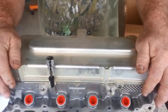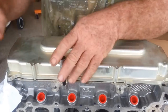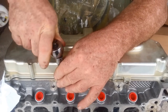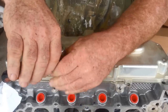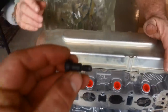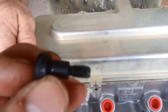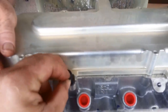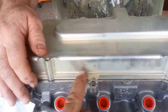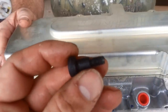There's one bolt left — that's a shoulder bolt on the valve cover. We get our Allen wrench and ratchet out and remove all the shoulder bolts out of the valve cover. Since it's called a shoulder bolt, that means you tighten it down until it bottoms out against the engine when you reinstall it. The distance of the shoulder is exactly what's needed to compress the gasket in the valve cover. So you tighten it all the way down until it bottoms out against the valve cover during installation.